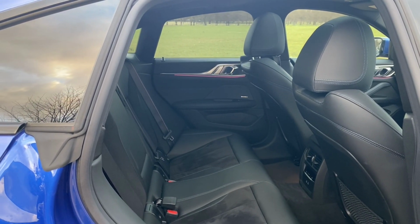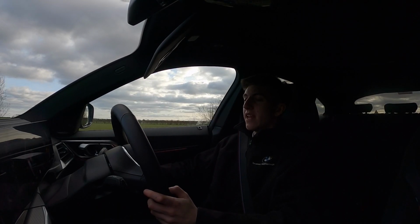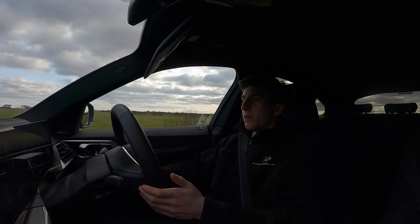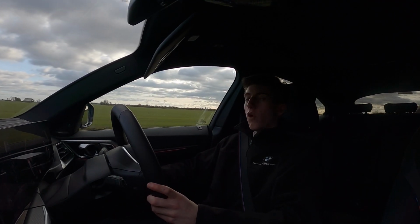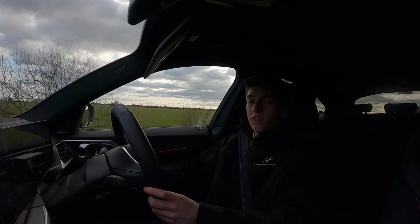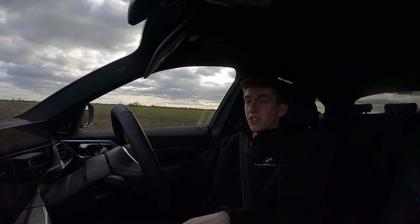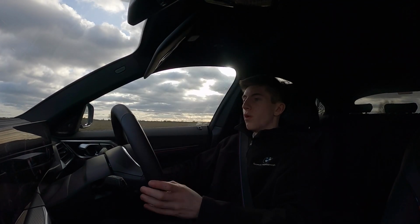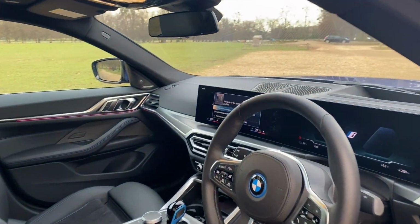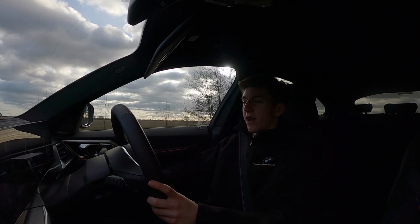And lastly, this is of course equipped with heads-up display. Heads-up display shows again the speed limit, your actual speed, any limiter you've got on, so I've currently got a 60-mile-an-hour speed limiter on, and what direction you're facing, currently northeast. However, that also will change to your sat-nav if you have a destination input into the sat-nav system. The heads-up display also warns you of any upcoming speed changes, whether it be an increase or decrease in the speed limit, and any upcoming junctions and roundabouts.